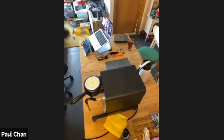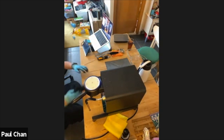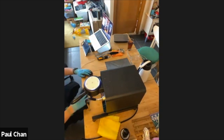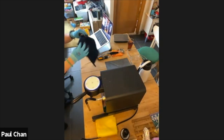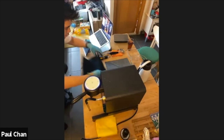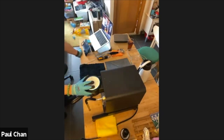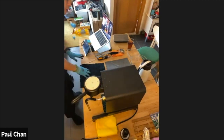One thing when you do transport mode is sometimes the water inlet pipe has some residual water inside and will drip onto your table, but it's only a little bit, so don't be alarmed if you discover water on your table after doing this. It's simply from the water inlet pipe. Now that the machine is fully drained, I'll turn it off again, and we can go into turning the machine upside down.